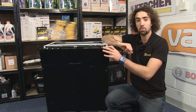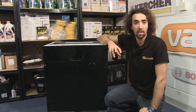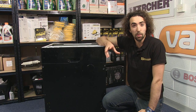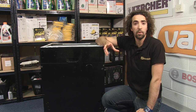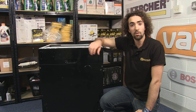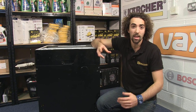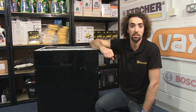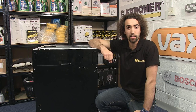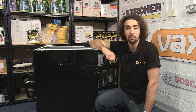One final thing to consider if you need to replace the control board in your dishwasher: many manufacturers make their control boards so that they have to be programmed when they are fitted. This is possible for you to do but it may require purchasing additional equipment, which can be expensive. So if you are replacing the control board, you may prefer to use a fixed price repair service such as Repair Care who can do the fix for you. If you need help with diagnosing other faults in your dishwasher, see our other eSpares videos, and spares for dishwashers along with other appliances are available on the eSpares website. Thanks for watching.